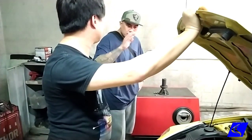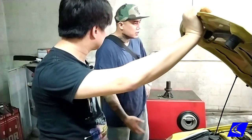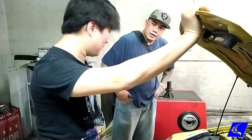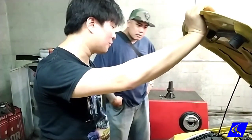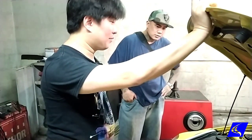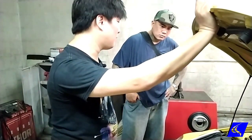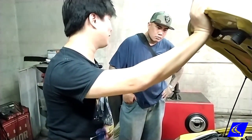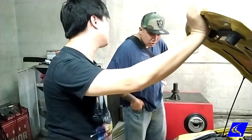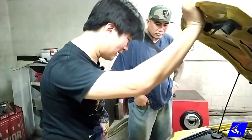No, man. When I got this, they paid someone else. It was right. Maybe they came with 98 because these things are high compression. They should have 97, 98 to perform better. That might be the other thing too. If we tune it and then we run into detonation mid-tune, we might require to drain your gas tank and fill it up with 97 or 100 octane. So those are the things that I'm just telling you from what we know and what I can see.